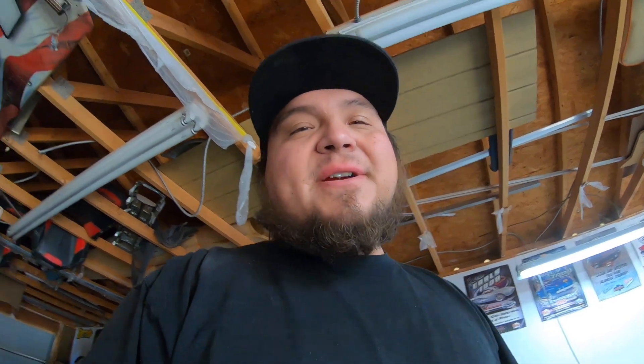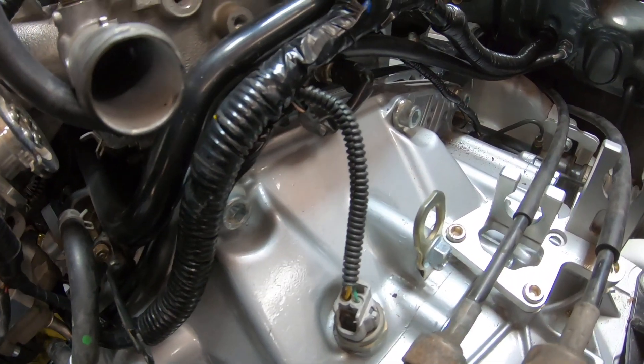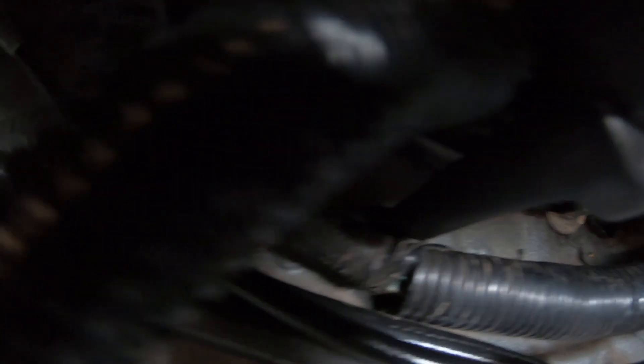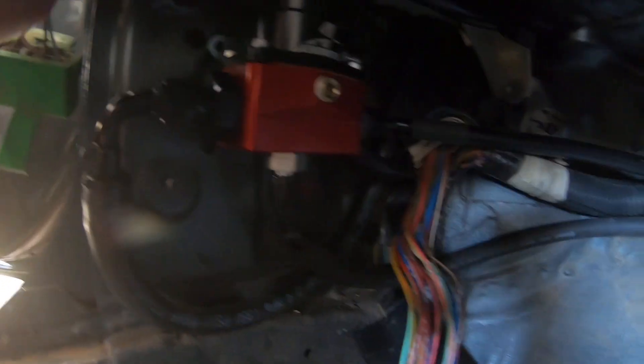So on last week's video I showed you guys that I was running the harness in the firewall using the K-Tune plug, and I said I was going to put a bulkhead in there for the fuel — and I'm already doing that. I'm going to show you what that looks like right now. It came out pretty clean, and when it goes inside the car it goes straight to the fuel pressure regulator. Here's where the fuel feed is right here, and I just have that running down underneath the water line in the harness, going into the firewall right there. When it comes inside the car, it runs across the boxes and feeds right into the fuel pressure regulator.